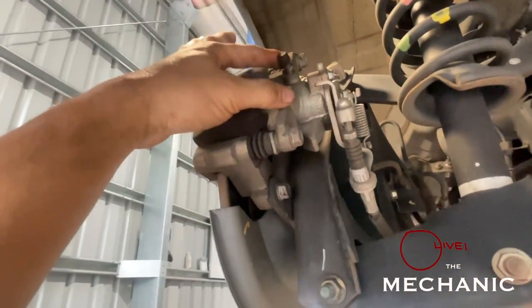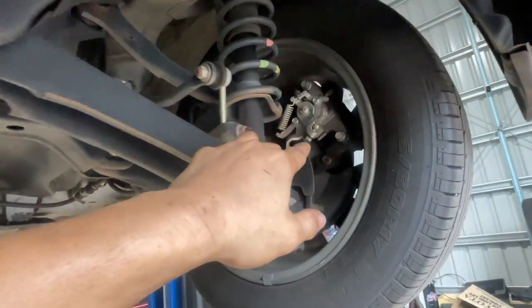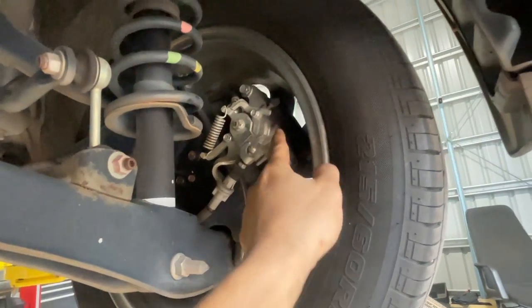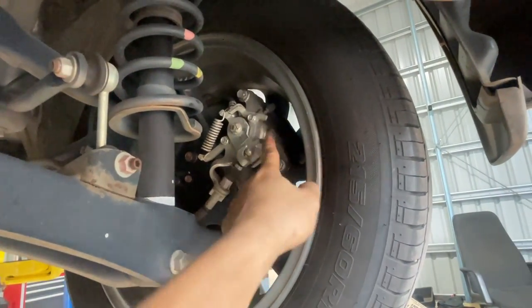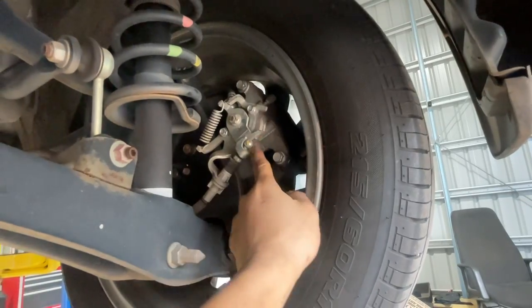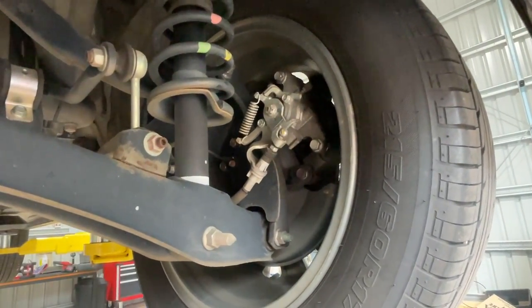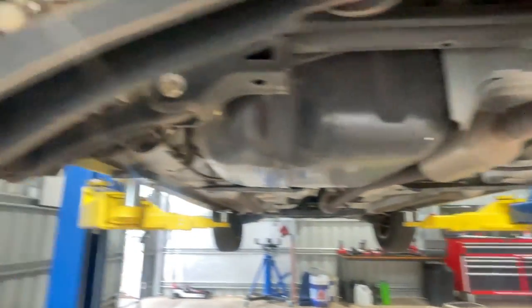At the back of the piston - you see the caliper - you can look at the bottom. You can look at the bottom of your car and if you can see the cable near the rear of the piston, that means it's a two-in-one. There's no handbrake shoe on this type. Yep, you can see it.